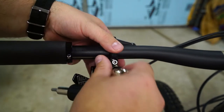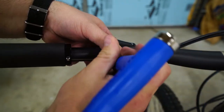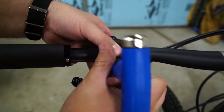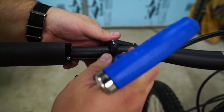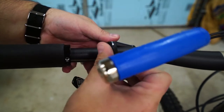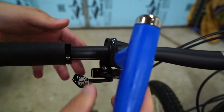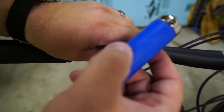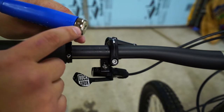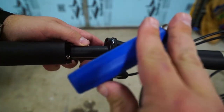Alright, here we go. We'll stick our 4mm screw back in — snug as a bug in a rug. Now I'm looking at kind of where my brakes were before, trying to match it up. These are pretty new carbon bars and I'm still working on positioning. The torque wrench is currently set to 4Nm, which is what I've done my cockpit at, and it seems to work out.